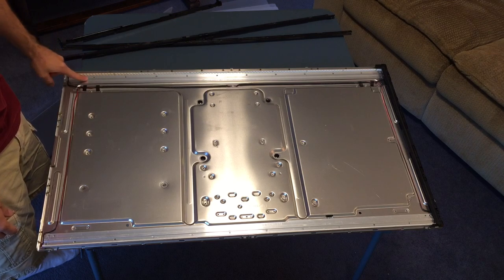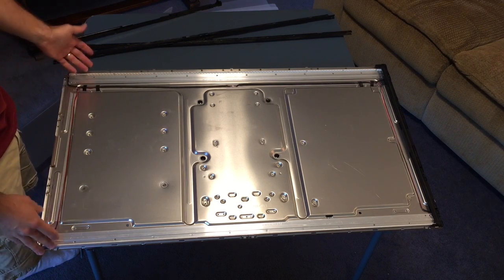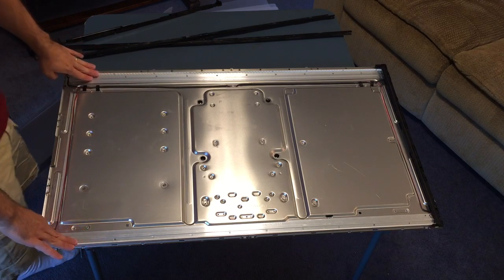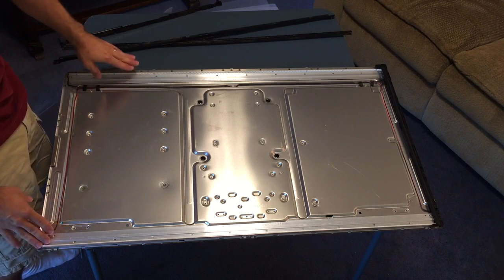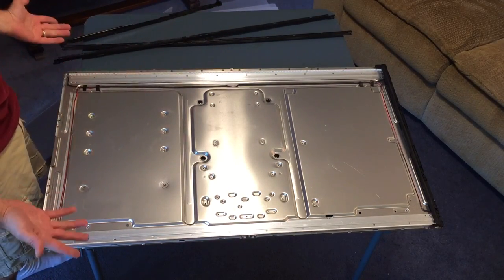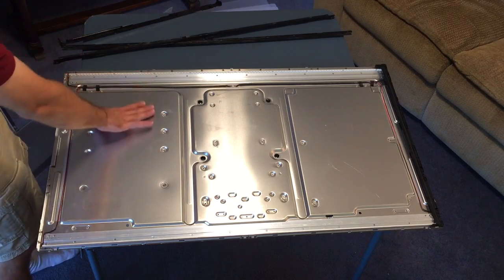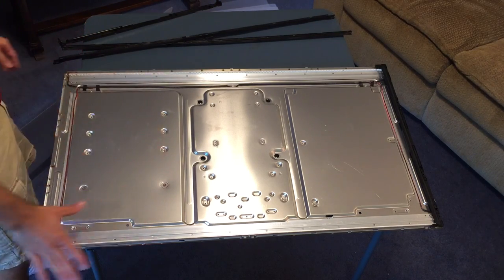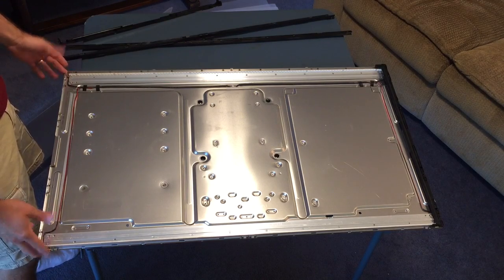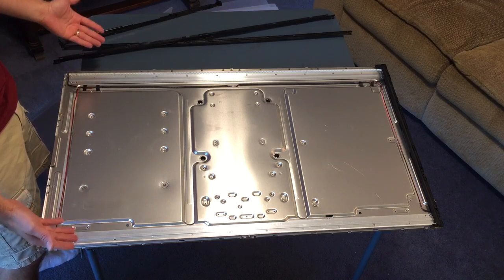On this particular model, the LED backlight is hooked up to a metal heat sink to disperse the heat. This is an edge-lit LED TV, where the LEDs are on the edge of the screen — some at the top and some at the bottom, running the whole length of the TV. Sometimes they're full LED array TVs where the LEDs are across the whole screen, but this is an edge-lit one.